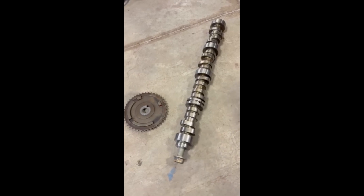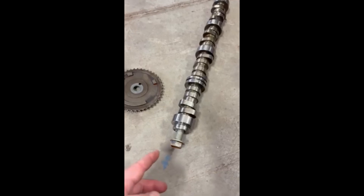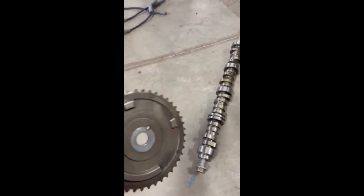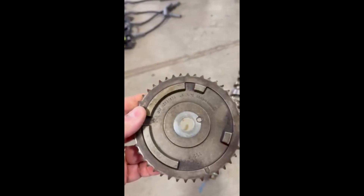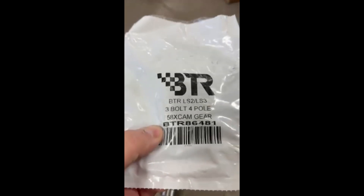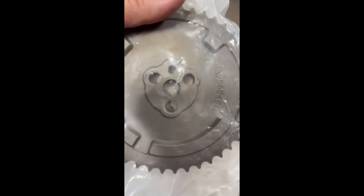Here's the original cam that came out of this 2014 Chevy Caprice — it's a police pursuit vehicle. This is a single-bolt cam in the front, with the single-bolt cam gear and your pickups for your cam position sensor. What Brian Tooley Racing did is they have that same deal — it's a three-bolt, four-pole, 58-tooth reluctor wheel and cam gear, and this cam gear looks exactly the same.